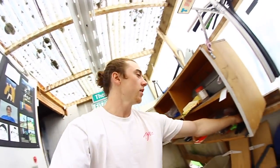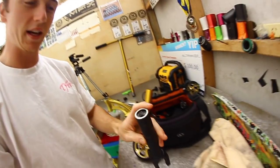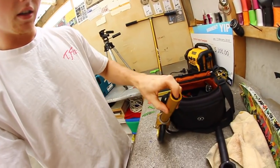Which is what I've done to these forks here, but unfortunately I kind of mucked it up because I cut them a bit too far down. With these forks, the drone forks like Apex forks, you need the top little bit to screw on, which I snapped off because I cut it down too much. So yeah, that's a quick little tip for me there. See you guys next week.